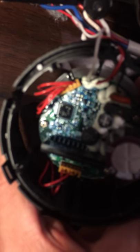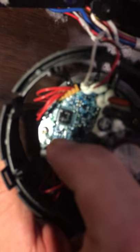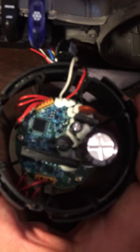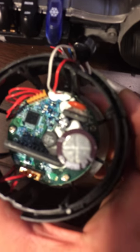I did look up this chip - I don't remember the number exactly, it's like a DRV with a five-digit number after it. This chip is probably five dollars retail, which is interesting. Unlike most consumer-level hair dryers, this thing is pretty advanced. Again, there are no brushes in the motor, so this thing really spins. You can spin the motor and it doesn't stop very easily - it coasts. If there were brushes, it wouldn't spin like this. So it's a pretty nice design.